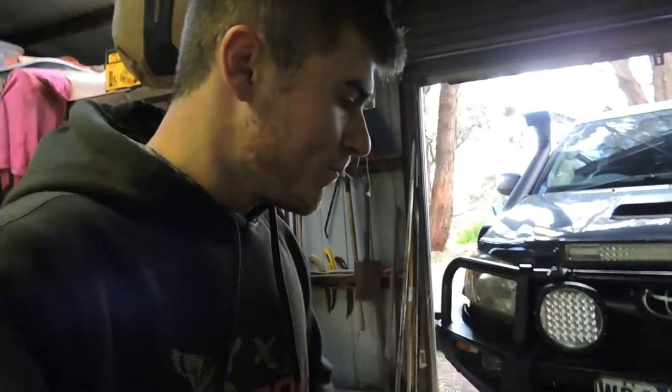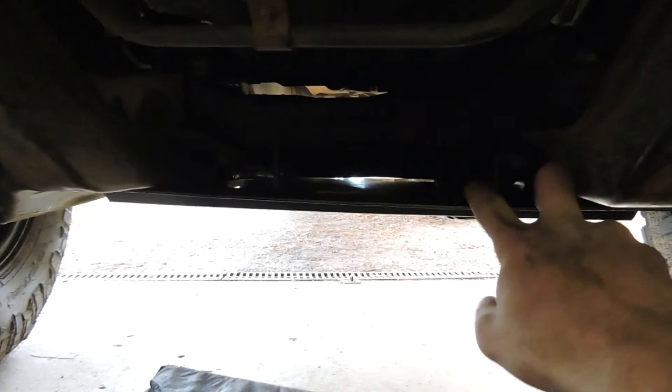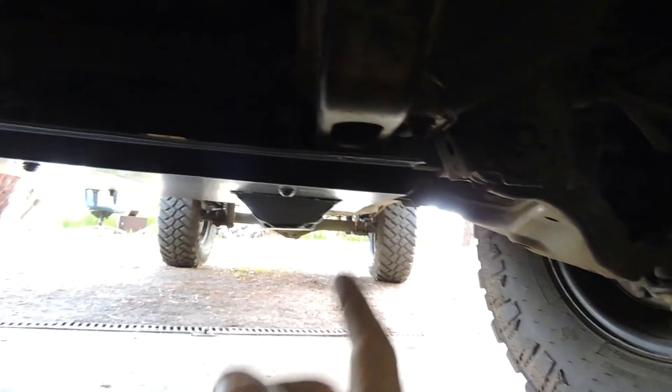The bash plate is in the car. I bought longer bolts but they're not actually long enough — I'd like them a bit longer to make life easier. Because of that warped plate I've got some spacers out of some pipe, looks like about 3mm, which should be enough. There's a bolt there and a bolt here, and the idea is I'm going to put those spacers over those bolts so it's clamping the spacer to the cross member — that will be nice and strong. The diff actually just touches here, which isn't ideal but it's fine.